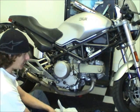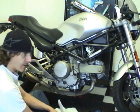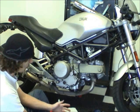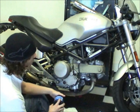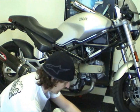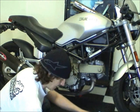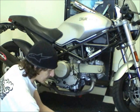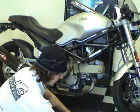This is the first time I've ever done it without using a jack, and it looks like it's going okay. But I'm going to go ahead and bust out the jack so you can see a good cheat to do. If you get this thing binding or if you're using a lot of force, by using the jack you're making it so you relieve some of the stress, some of the shear load on the bolt, and they should pass through easier.